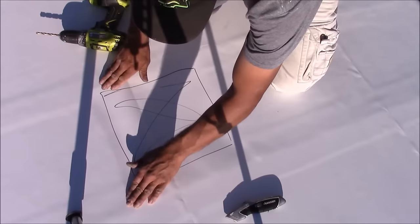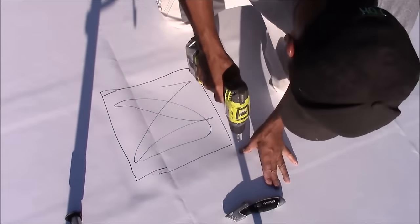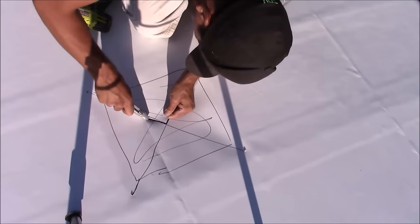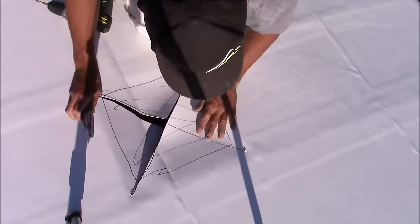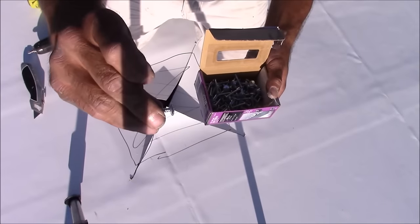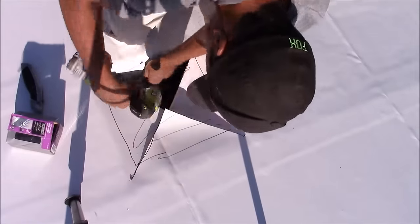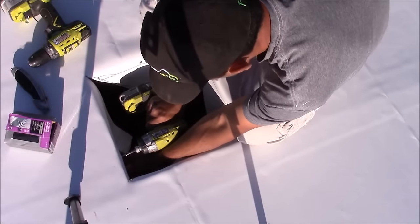Now it's time to start cutting all my holes for vents and covers. What I'm going to do is drill a quarter inch hole in each corner, then mark it with a marker and cut with the utility knife all the way to each hole I drilled. Another way is to cut an X first with the utility knife and then use a hole puncher at the end of your cuts — the hole protects the material from ripping past that point. Now I'm going to use some screws to secure it to the side of the opening; these are self-tapping screws with a pan head so they're nice and flush. After securing all the edges, cut off the excess material with your utility knife.